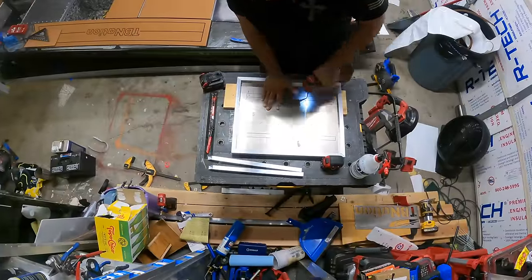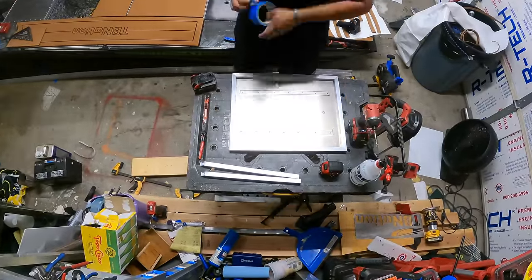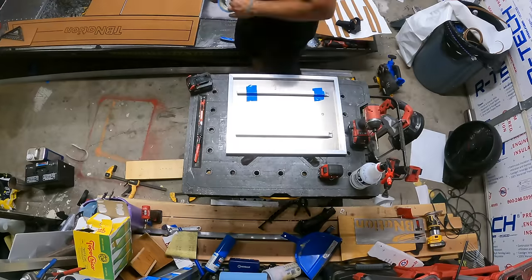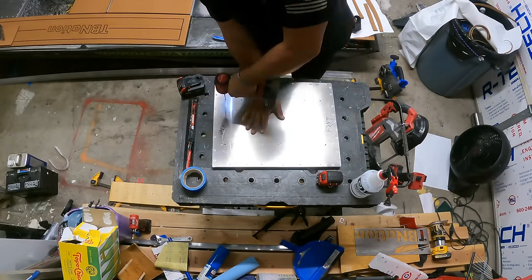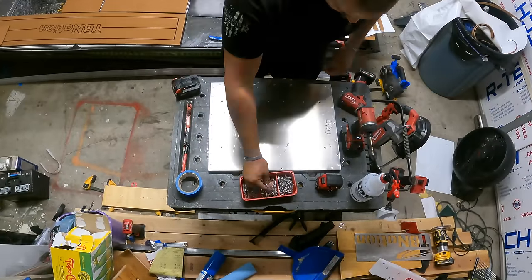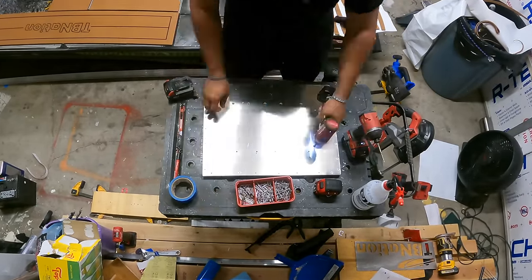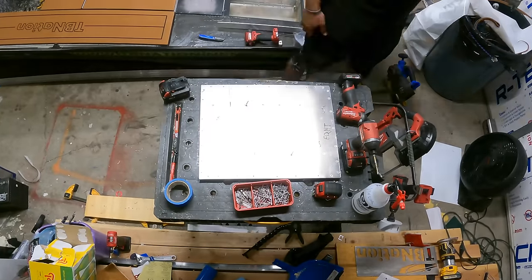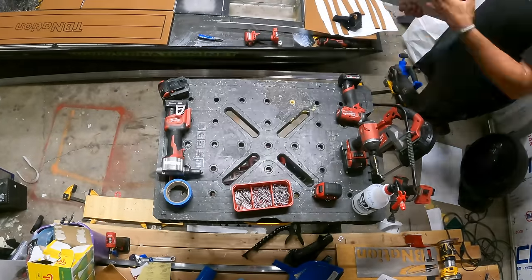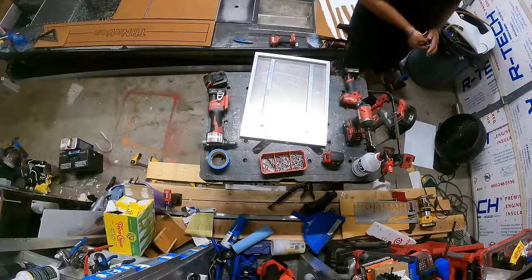And then here's the front hatch with a Gen X frame. And we found that sticking just a few pieces of tubing in the middle does really good. And if you really want it ultra stiff, one of my patrons figured out that all you have to do is put another piece of sheet metal right on top of the tubing. So you pretty much have a fully boxed under support. And that makes the hatch extremely rigid and inflexible.